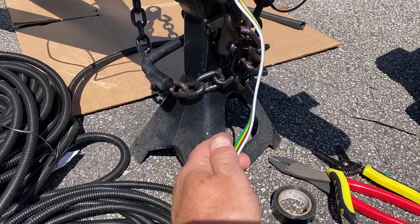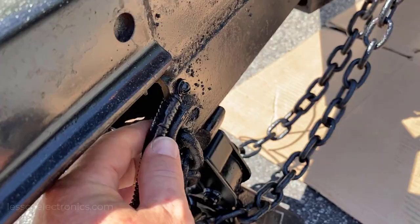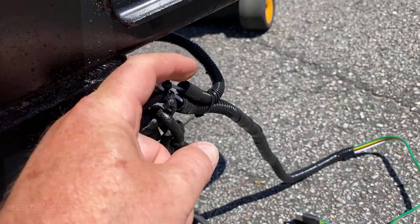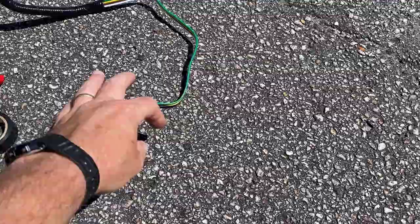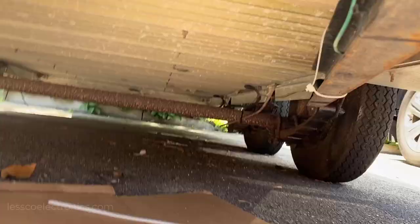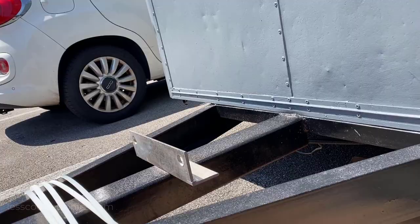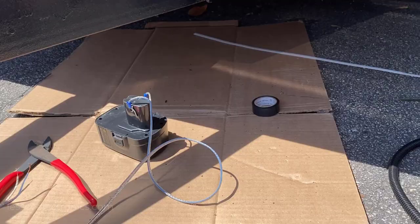Before moving to the back lights, here's what the front looks like completed: ground strap taped and insulated, four-pin flat in three-eighths loom insulated with electrical tape, run out plenty to connect to the truck, running inside with loom through the frame. Look at what a difference wire loom makes compared to raw wires — the raw wires look ghetto. I branch off with quarter-inch loom so it all looks nice and neat. I'm using large wire ties for the frame sections, but if those are expensive you can link two regular eight-inch ties together to make a longer one.